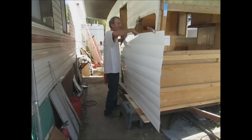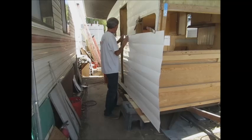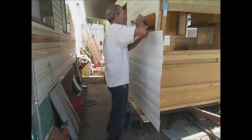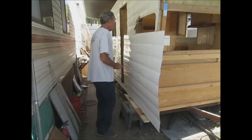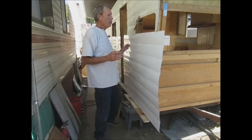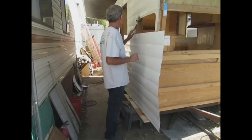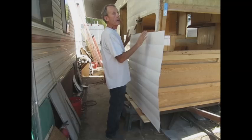You do this to get it in there — run your hand along here to get it to go up into that seam everywhere. Now I've got that under the seam, I can get this side under the seam too. It does bend a little bit — now you're under the seam. I'm going to put some staples in places where I know it's going to get covered up. Around this particular Shasta window, you can't put any staples here because none of this gets covered up.